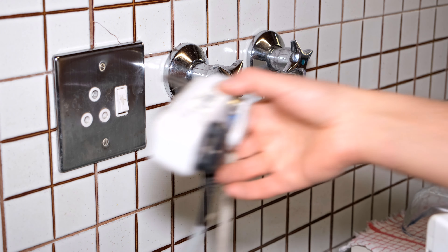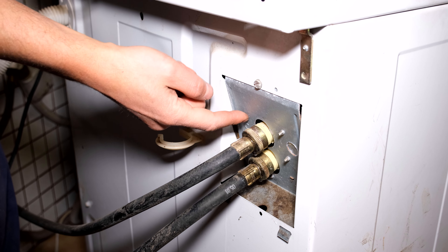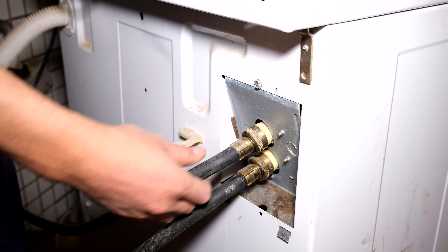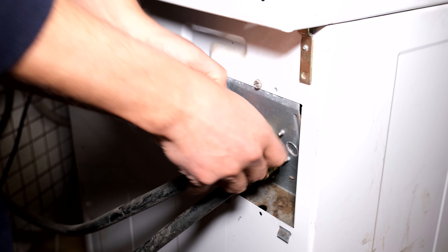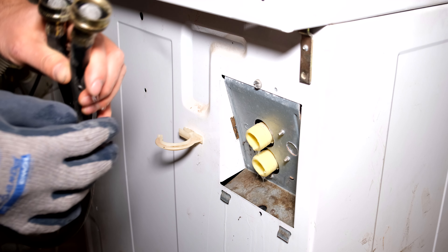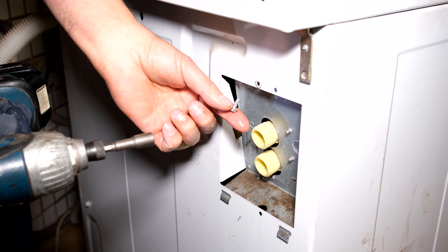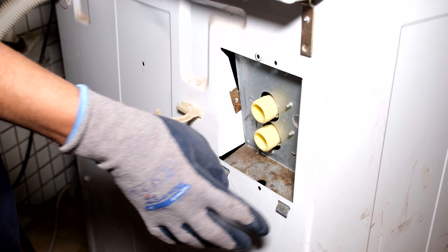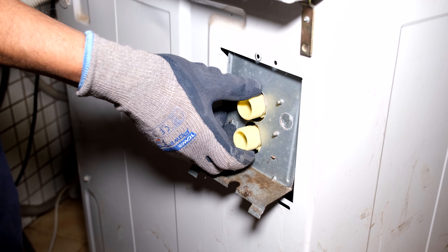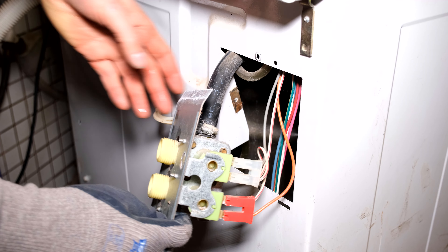Make sure the power is off - unplug it from the supply and turn your taps off. I need to get to the solenoids, the inlet valves, which are over here, and I also need to remove these pipes. This is a size 8 screw - just remove it. You can see these protrusions coming through here, so I need to push it inwards and up and it comes out. You can actually see the solenoid now.